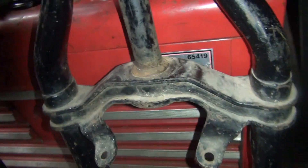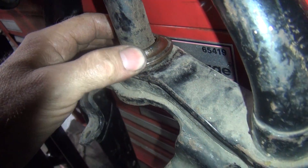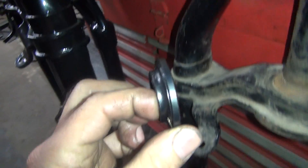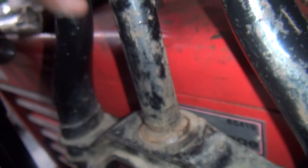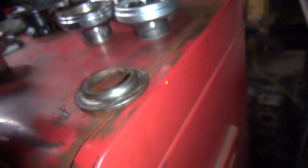The next problem is this lower centering race here, which is what your bearing race goes on to right here — it self-aligns. There's supposed to be a small gap in here, about a tenth. Now, when you use the V-twin race, which is this one on there, you have a gap that's probably about twenty-five thou. So this bearing race here, this inner cut here, is thicker than the stock one over here.